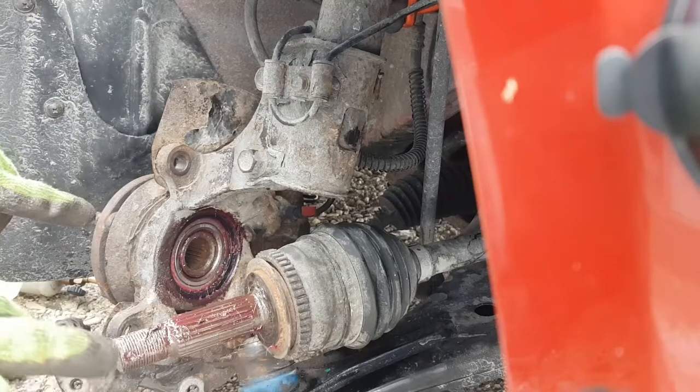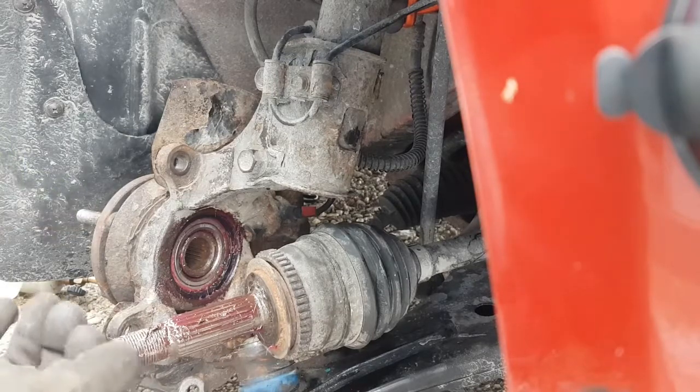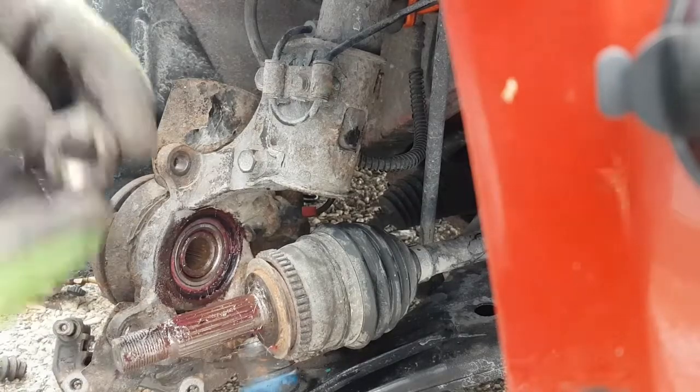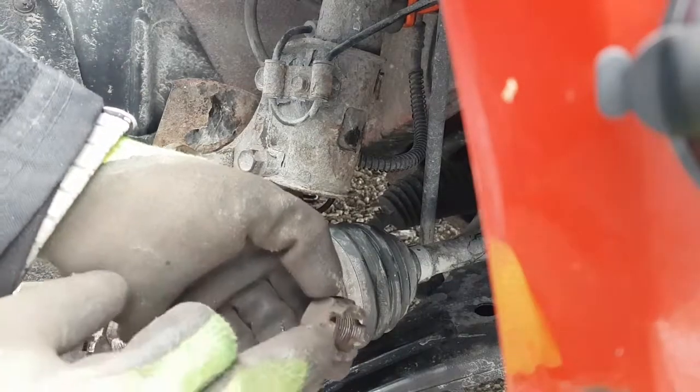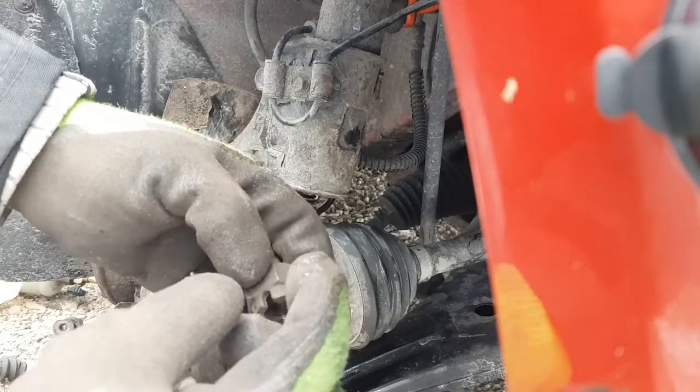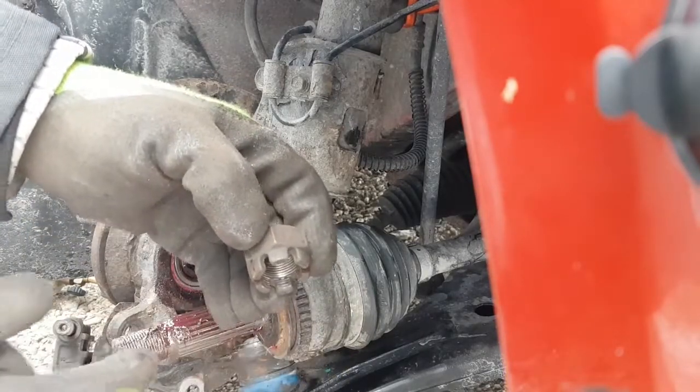it's not so bad with cotter pins, but if you got the one that has the stake nut, it's so where's that stupid nut? You get some of these that don't have the holes for a cotter pin. It's just like a round ring, and then basically you take a punch and a hammer and you knock it over into a groove in here.